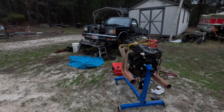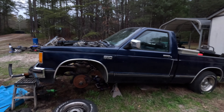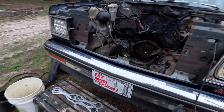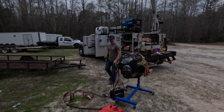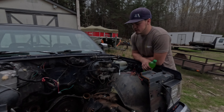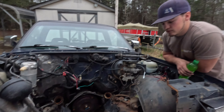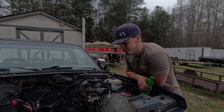This is the truck it's going in — my truck. It's been through some things, seen better days. Got everything set up, motor mounts in. We had a stock motor in it — bone stock 350 — it lasted a day. I drove it one time, had a dent in the oil pan, cavitated the oil pump, whacked the throttle, and it did not enjoy that. Great cruising at low RPM but that transmission and the revving caused it to cavitate.